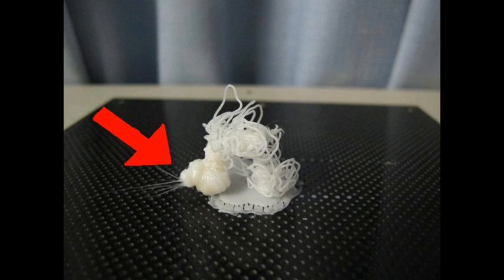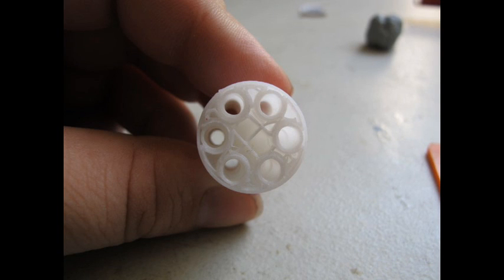What I'm really worried about is where the arrow is pointing — a giant molten piece of plastic with hair sticking out of it. The nozzle also had a lot of black carbon gunk on it. I tried clearing the nozzle and set up for another print. It printed very little of the second Gatling gun and just stopped and started printing in midair again. Tried cleaning the nozzle from the outside wearing gloves and used the maintenance menu to extrude a bit of plastic — nothing happened. Tried to remove and re-feed the plastic reel but the extrusion motor was jammed; plastic could not come in or out.